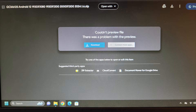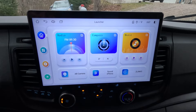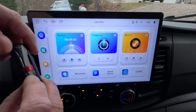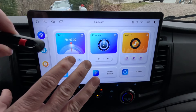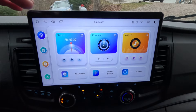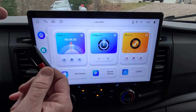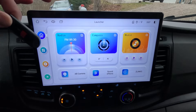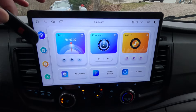Unzip or extract that file — it will save as a folder. Copy everything in that folder to the root of a USB drive. I'm using a SanDisk Cruzer Glide 16 gigabyte. There are a few things to consider about the thumb drive. When I first tried, I used a 64-gigabyte drive formatted as exFAT and it wouldn't complete the update. You must use a thumb drive smaller than 32 gigabytes — 8 or 16 gigabytes is plenty — and format it as FAT32. That is very important.